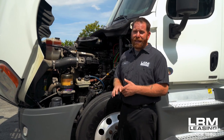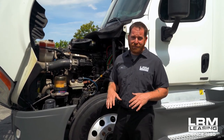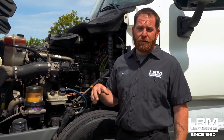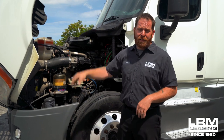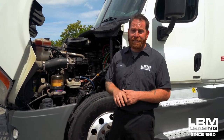A good way to figure that out is: when you're driving it gets cold, when you're sitting still it gets hot. Then do some pre-maintenance things — especially if you have animals inside your cab, you may want to clean the fur and pull the inner filter. And if you go through a dust storm, make sure you replace the outer AC filter as well. That just keeps things breathing and doesn't create a choke point in the AC system.